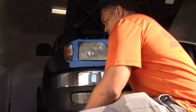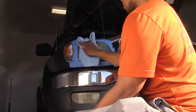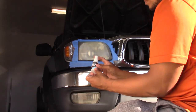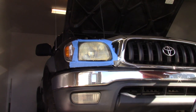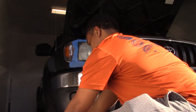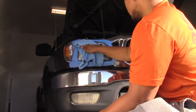First step is to clean the headlight. I'm using a Simple Green solution here, but a mild detergent and water would work just as well — make sure you dry this off completely. Next step is to apply surface activator. This cleans any yellow staining and removes any previously applied clear coat. Apply this pretty heavily, but leave at least half in the bottle because you'll need the extra half for the last step. After about 30 seconds, go ahead and rinse this off and wipe the headlight down again to remove all the old grit.